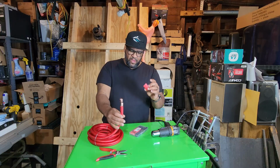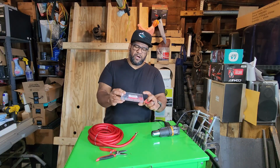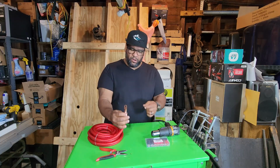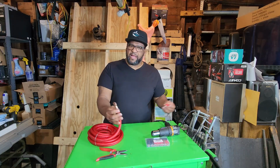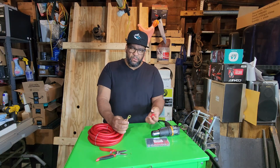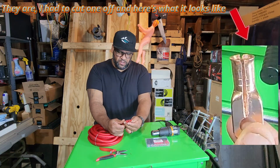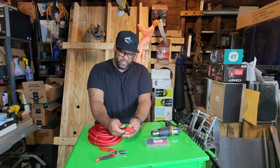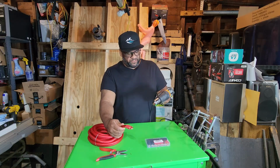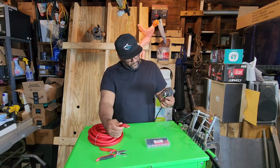And this kit that I purchased, which will be in the link too, these are 0 gauge lugs with a 3/8 hole and a center. I got those off of Amazon. They say that they're copper. Whatever, it works for what I'm looking for. So here's the heat shrink on there, and this is typically how I do my heat shrink. Let's just heat her up and see if she makes a good seal, and if it's a good seal, it's a good deal.